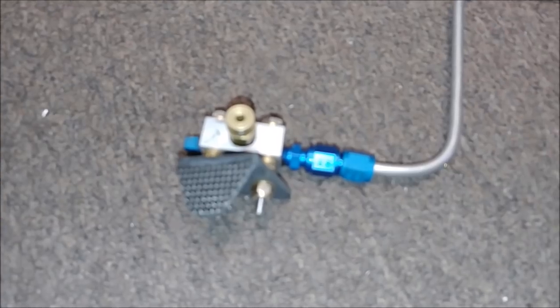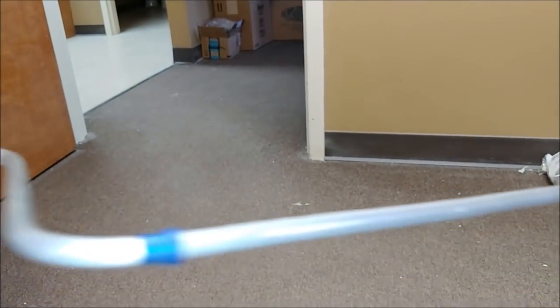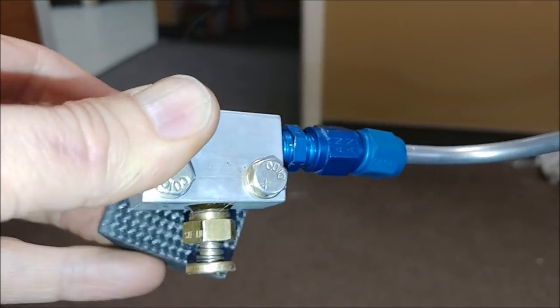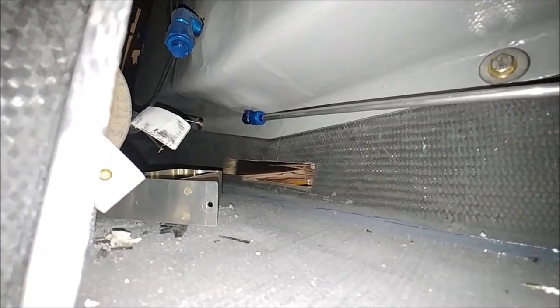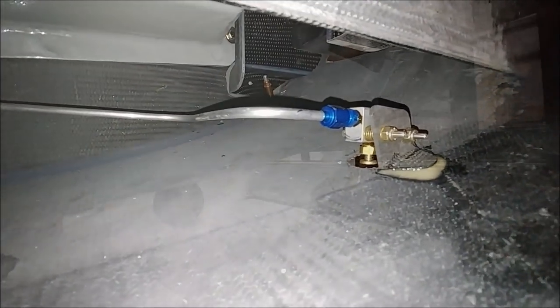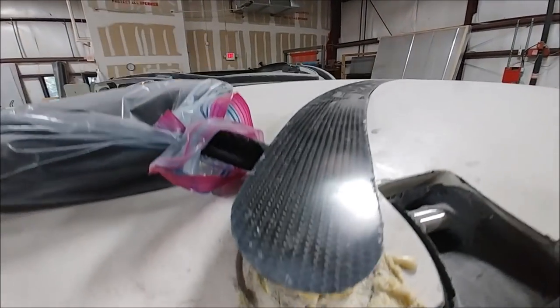Here you can see the little remote fuel drain setup, so you can drain any water out of the tank. The bottom of that drain is in the middle of the header tank, and we wanted this to be remotely mounted off the side of the aircraft so you didn't have to climb all the way underneath. There's a line running downhill to a little drain valve — you just push your little cup against it and it drains the fuel or removes any water. He's put it in place, hooked up to the bottom of the header tank, and bonded the little bracket onto the inside of the fuselage with a hole cut through, so looking from the outside you can just see the opening there.